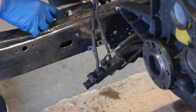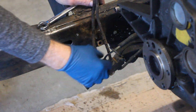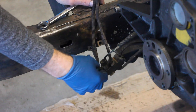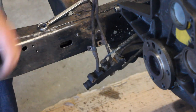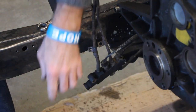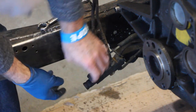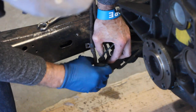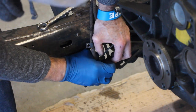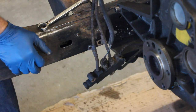I need to take a detour here. Instead of taking the brake proportioning valve off last, we're going to take it off first. I haven't taken this off yet, but as I pushed the piston in on the caliper over there, it started pushing brake fluid right out through the pipes. So it would probably be a good idea to drain this thing first and put a cup underneath it so I don't have brake fluid running all over the place.